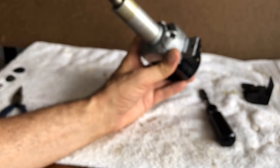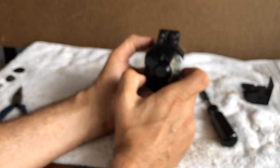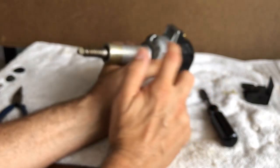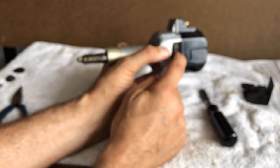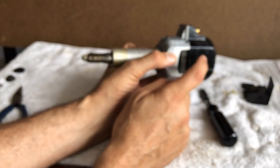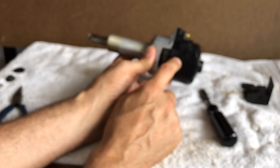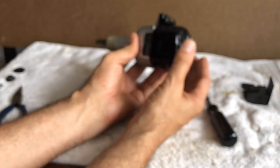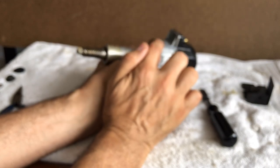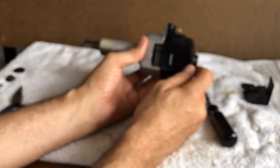On the other side of the motor are also two very long bolts that actually hold the two halves of the motor together. I am not loosening those. If any of you ever take these motors completely apart, there is a clip inside that sits between the Bakelite housing and the motor body. If you take this apart, watch for that clip — it can fall on the floor or disappear inside the motor. I learned this the hard way: it has to go back in its proper spot for the motor to be properly reassembled. It's almost a little Z-shaped clip, probably three-quarters of an inch. Be aware it's in there.